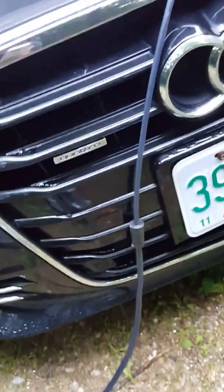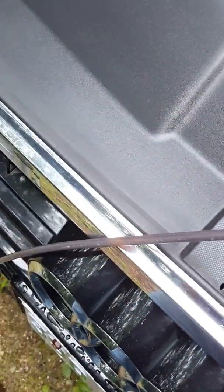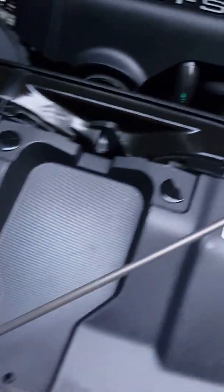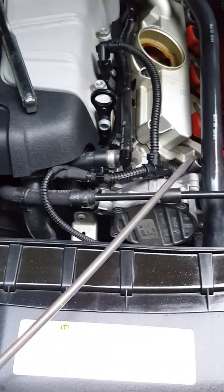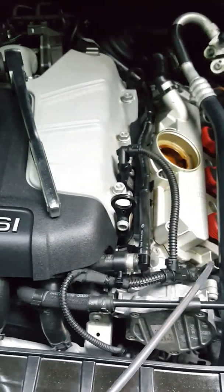So now that we got that in there, let it kind of trickle down. Give it a couple more pumps. And just maybe we'll see the oil look a little cleaner coming out of it. And not so much. Now the color coming through now is definitely a lot lighter. It's not totally black, so I know I'm definitely grabbing some of that fresh oil out. Which makes me think I got it all. So we'll let that do it, and I'm going to pour in the oil, 7.2 quarts.